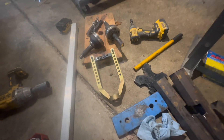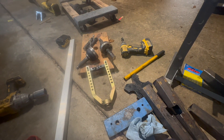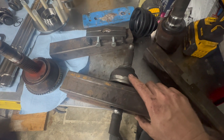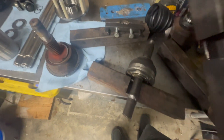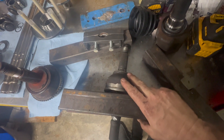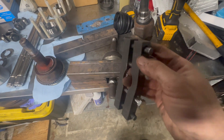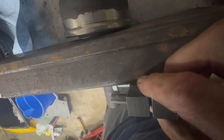So I just started getting creative, and this is what I came up with. I took some two-inch bar stock, cut out three-inch pieces with three-quarters of an inch on each side, placed it like that, and then this sat on top of the press. This basically goes on right there — you'd bolt this on normally — and then once bolted on it sticks out maybe like an inch on each side.